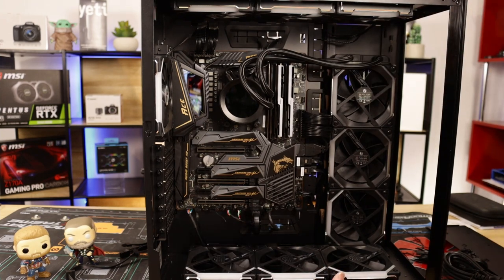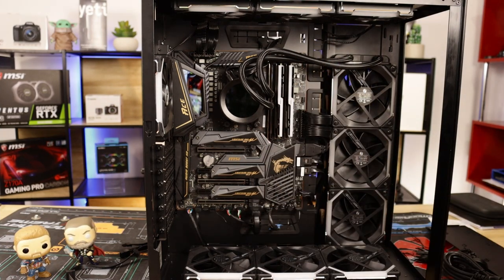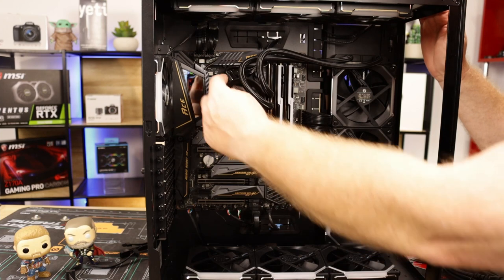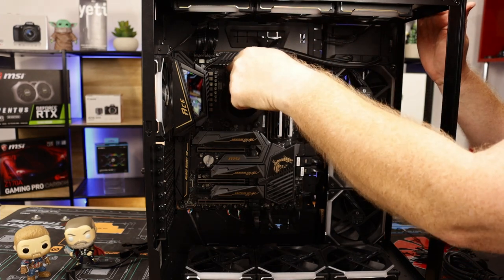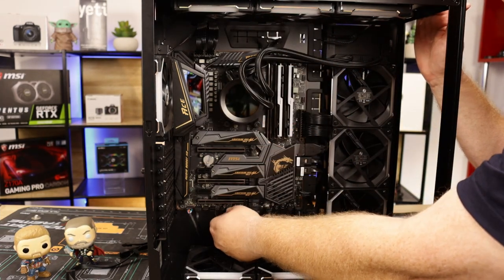There's three cables for the hub, which powers all 10 fans. And obviously your other three fans on the back of the radiator from NZXT. They're all powered from the USB and these connections up here on top of the pump, which are fed through the top. USB goes up through the top, goes down the back of the board and comes up and is plugged in here.